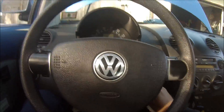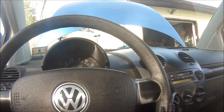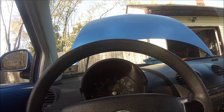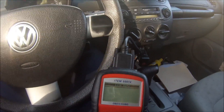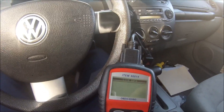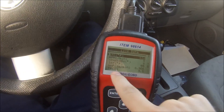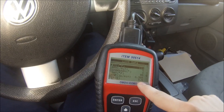In order to recalibrate this thing — if you go on a bunch of forums or particularly if you go to the dealer, they're going to tell you that you need to bring it in and get your engine control module reset. That's total BS. What you do is reconnect the umbilical as I showed you, and this applies also if you've replaced your throttle control module. Now you'll see a reading on the TP percentage — we're now at 3.5, which is the nominal throttle-off, engine-off condition.